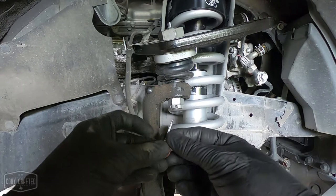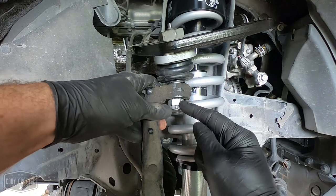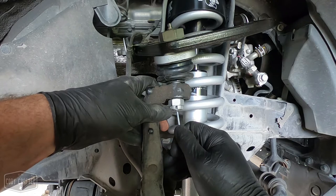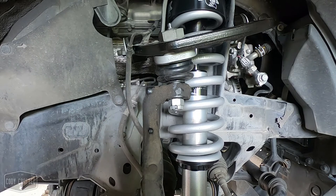All right, one of the things that's very important with castellated nuts and pins is to make sure that you go through and have full engagement, so that the nut not only can't back off, but it also can't tighten itself. I have actually made mistakes in the past where that hole was here and I thought, oh no, it'll be fine, because it's not going to back itself off on a wheel bearing. And no, it was on the right side of the car and it over tightened itself going down the road. So that was bad.